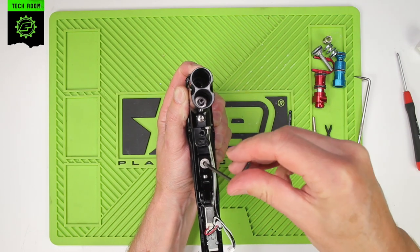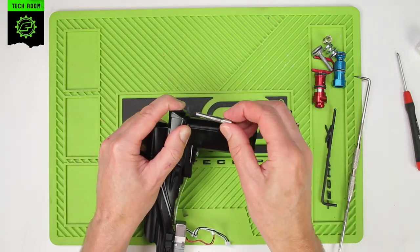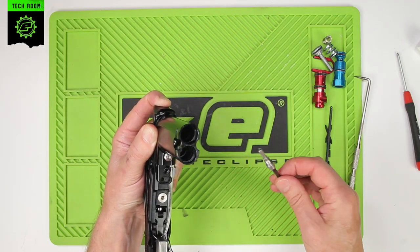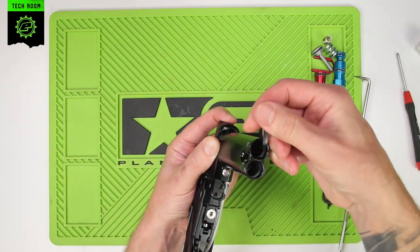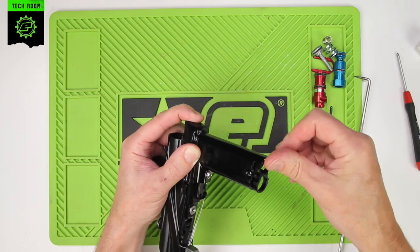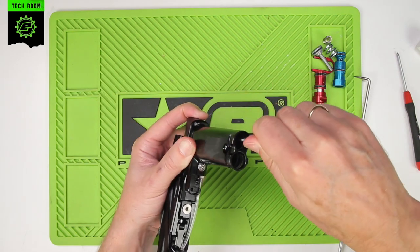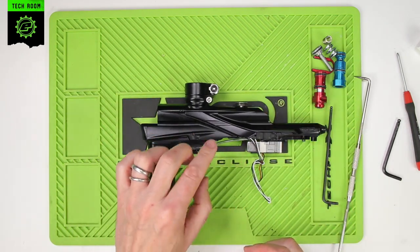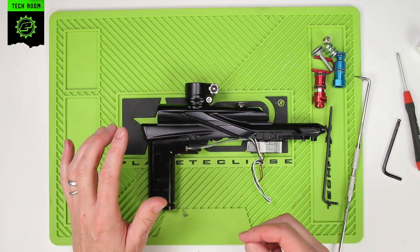Once you can confirm the orientation is correct, insert the valve plug. This does not want to be over-tightened — just screw it in until it stops. Then drop the locating screw or retaining bolt back into place. Assemble it onto a hex key and insert that all the way in, then tighten it back into place. Again, it does not need to be excessively tight — screw it in until it stops. You've now removed the valve guide and exhaust valve and reinserted it in the correct manner to prevent damage to those critical parts and sealing surfaces.